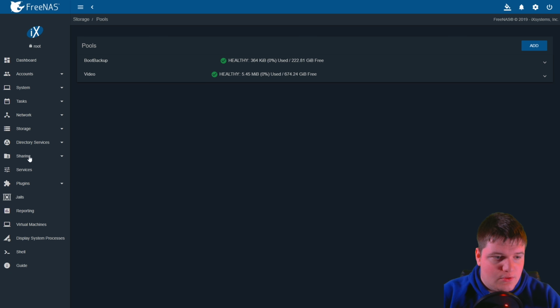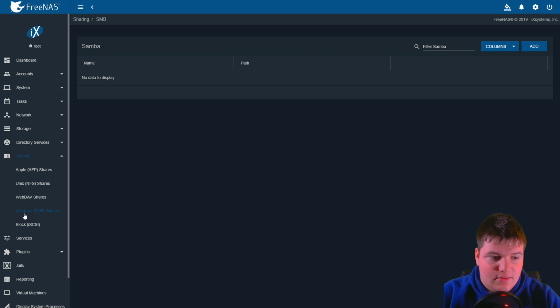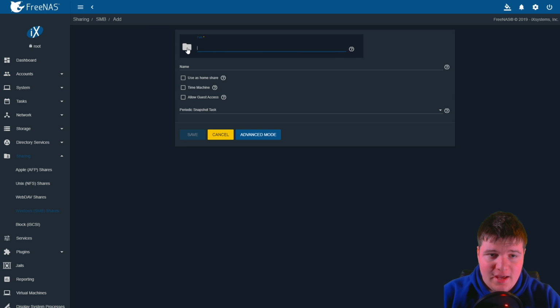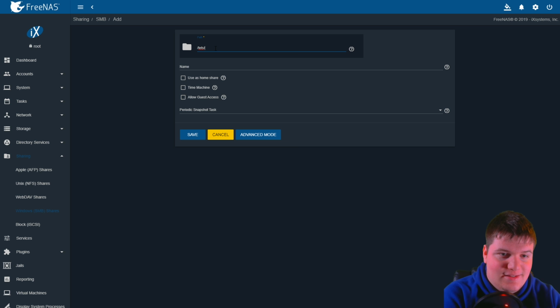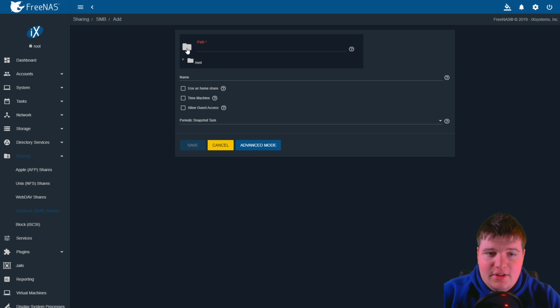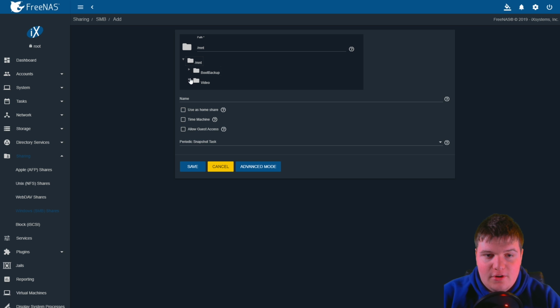We're going to go to sharing, and I want to create a Windows SMB share, since I'm using a Windows computer and pretty much all my main computers are Windows. So go ahead and hit add here. For the path, we can click this little folder here. This stumped me for a while. I was trying to think, what am I supposed to type into the path? So I was trying stuff like test. But no, you can click this, drop it down, and for one share, I'm going to make it my video share. I can just click that, and bam, it's got the path there. So I'm going to save this.